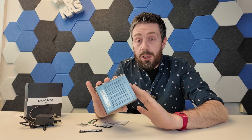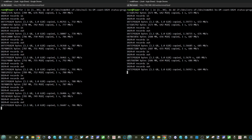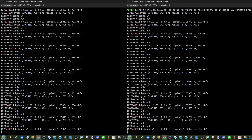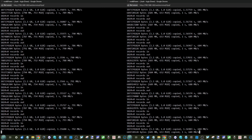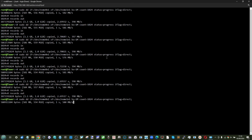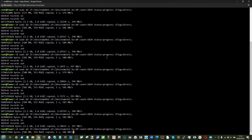Despite that, the performance numbers I achieved on the drives were pretty good. Each drive reported around 780 to 790 megabytes per second on repeated 1GB read tests over SSH in Unraid. On write, it dropped down to 680 to 685 megabytes per second, which is quite typical for the majority of N100 systems I've used. I was also quite impressed with data transfer between drives — we achieved 390 up to about 500 megabytes per second moving data from one SSD to another. All pretty impressive.